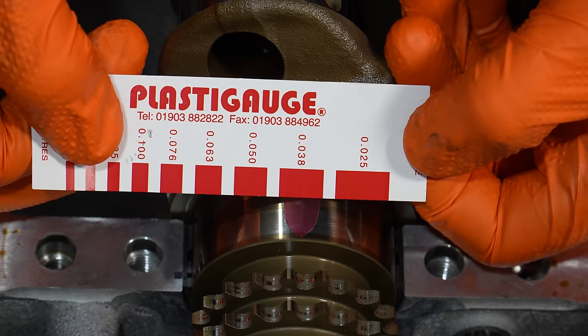Bank one cylinder head going on. Brand new head bolts. The torque spec is 40 Nm, then 90 degree angle twice, torquing from inside to out in a 1-to-10 sequence. There's not much metal here for a magnet so bolt down a steel plate for the magnet holder. 90 degree angle — first round done, second round done.